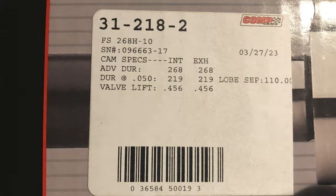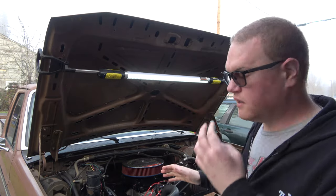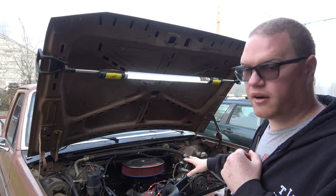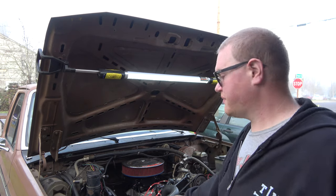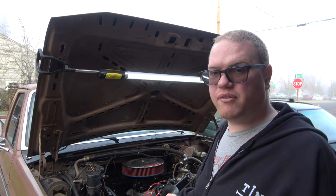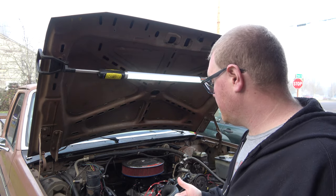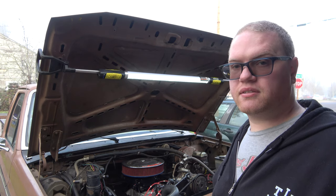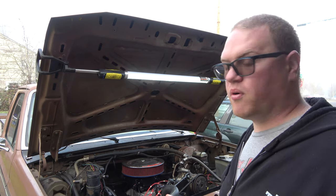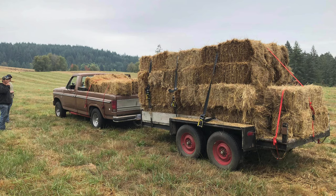Double roller timing — no plastic stuff, that was pretty much trash. It's not a roller; it's a hydraulic flat tappet. So far I've gotten pretty lucky about not flat-spotting the cam. I didn't even really break it in properly — I just ran it and gave it about 1,500 RPM. Still running good. I've probably got at least 5,000 miles on it, if not more. I've been driving it quite a bit and using the crap out of it for hauling stuff because it does so well, it's comfortable, and the air conditioning works.